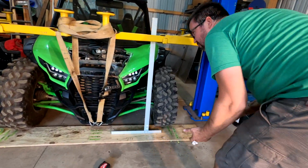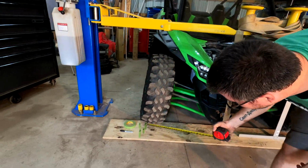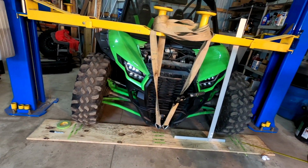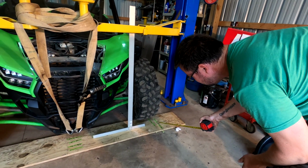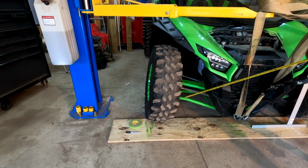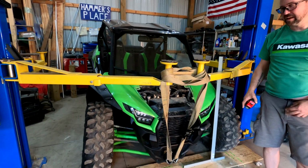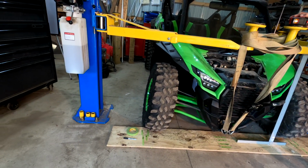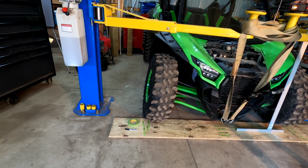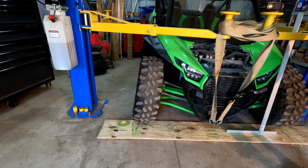I want to say a 1/2 inch. I don't think it's even that. Yeah, because we got it from full compression, so this line stayed the same. So from 2/3 to full compression, this tire never moved on the ground. All we saw was a 1/2 inch of scrub on the front tires, and I think that's our error because of our setup. Well, you're not going to get all the scrub out of there. There is some, but this is not amazingly scientific, guys. We're using scrap and stuff. We're trying to show you the best way possible.